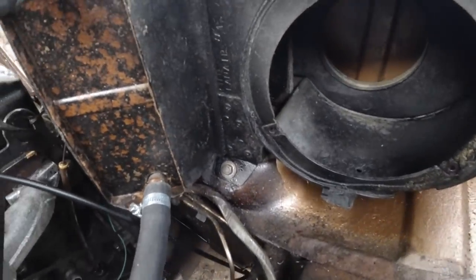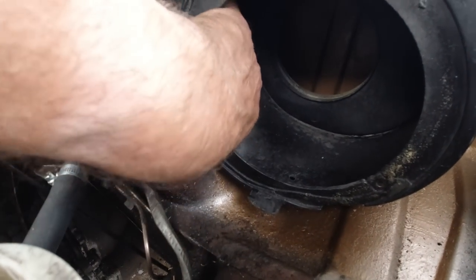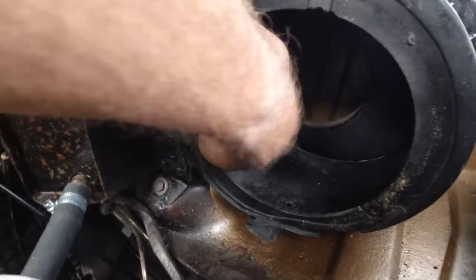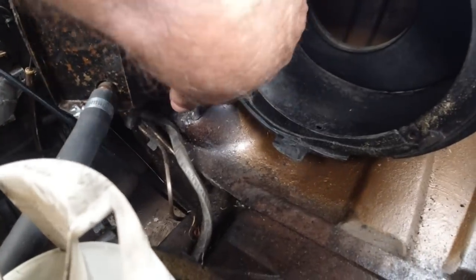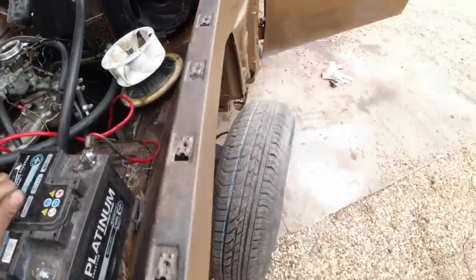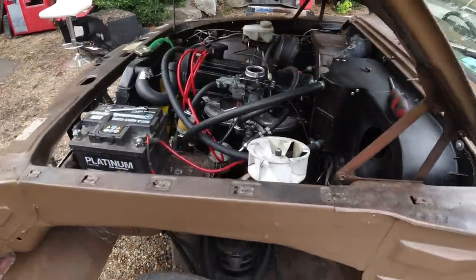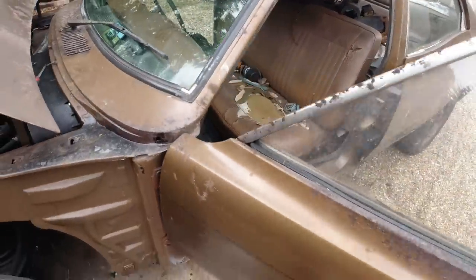Now, what I've got to do is make sure the flap is in the hot position, which is going to be across here. By the way, the matrix is leaking. We're going to need a new one. That one we tried to salvage has not worked. Right, we're in the hot position there. I've been fitting the lever. In fact, really, I should jam that in the hot position. Let's jam that. I'll show you the lever and stuff in a sec.